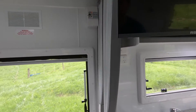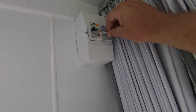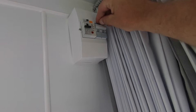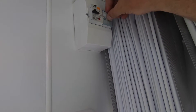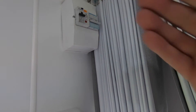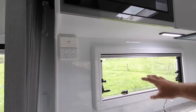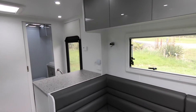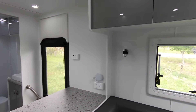There's a few different ways of doing this but we've done this caravan with a three-way breaker here. One way will be shore power or mains from the socket outside, where you plug in a 16 amp lead to a campground, house, or generator. This position is off, and this position means all the power points come through the inverter. So any of these power points can now convert to an off grid power supply, basically using the inverter, batteries and solar from the sun.